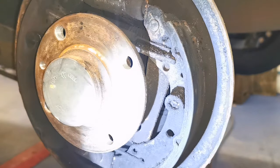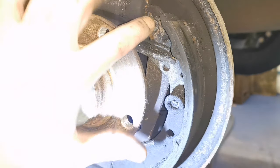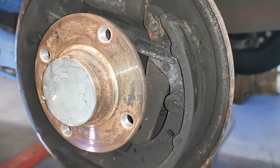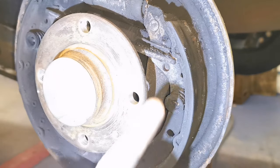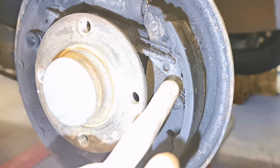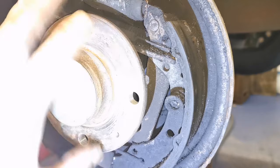What I'm going to recommend to the customer is we just put a new set of shoes on, because these are clearly worn with them being stuck on all the time. You could take these off, free that up with a bit of penetrating oil and move it back and forward. But the way I put it to customers is: if I have to take these off, what's the point putting these old worn things back on again? The work is taking these off and putting new ones on - these aren't expensive, so just put new ones on.